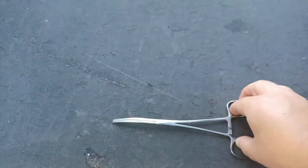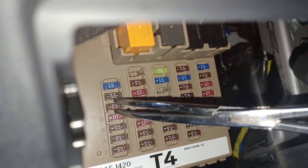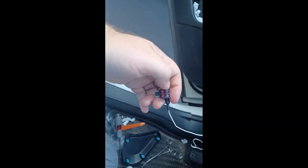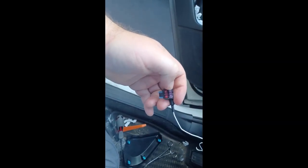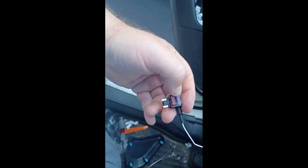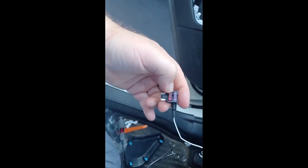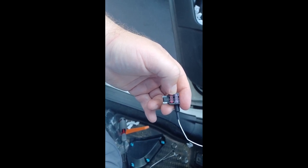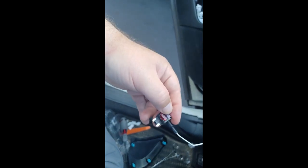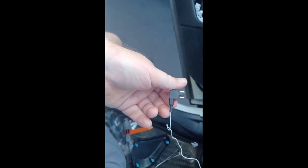And there we have it. I decided to put the 7.5 amp fuse in the spot where the purple 3 amp fuse is, but then decided to go back to the original configuration of the 3 amp with the 10 amp. I'm not sure why they would significantly increase the amperage of the fuses for the auto start eliminator, but I guess I'm going to throw the dice and trust that whoever built this knew what they were doing.